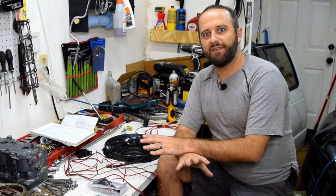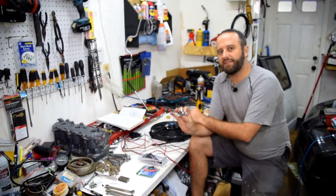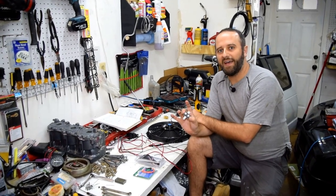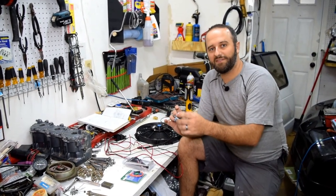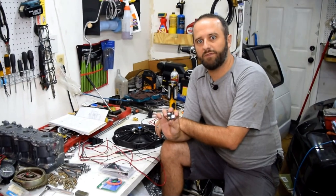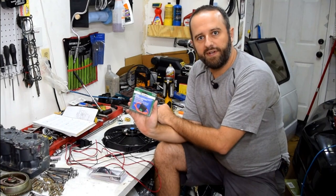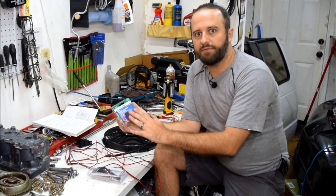When I was planning out this upgrade, there were a couple of things I noticed with the relay kits I wanted to change. First, each relay kit came with a small circuit breaker with dual terminals sticking out. I don't like having exposed positive terminals in the engine bay — they could easily be grounded out. So instead of the circuit breaker, I'm using a 30-amp inline fuse pigtail that I'll splice into the relay harness.